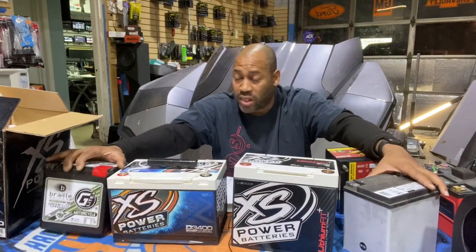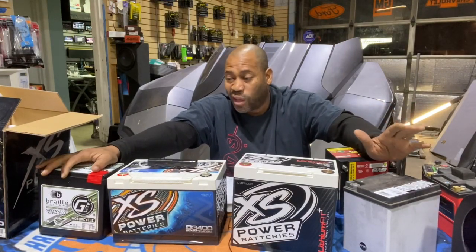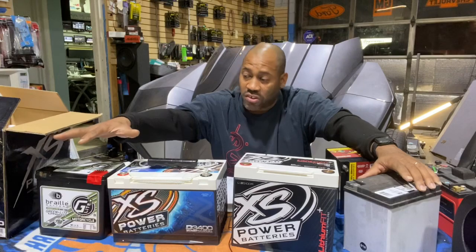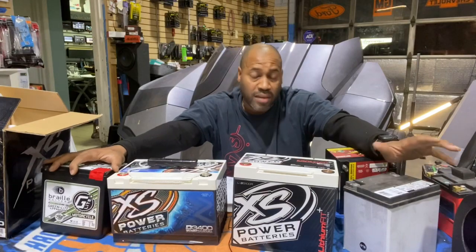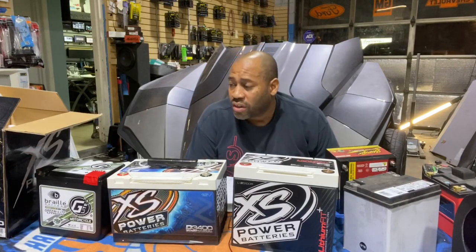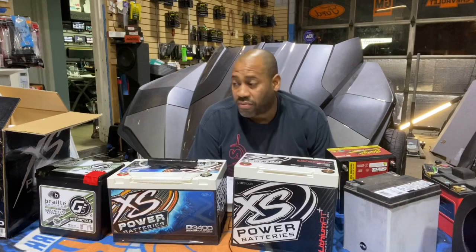The bike will run, the battery will supply as much current as you need until it reaches 11.10 volts and shuts off. You just won't be able to charge it until you're above freezing. It won't damage the battery, it just won't let you charge it. So a lithium battery completely outperforms any other type of battery. It just will not charge when it's frozen. So don't be afraid of the lithium battery. If you use the proper charger, everything is fine.